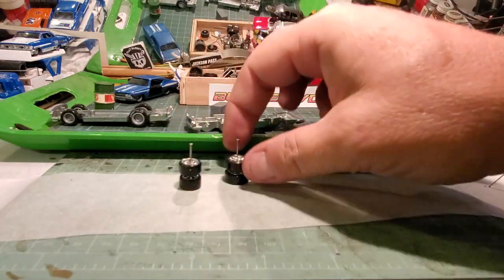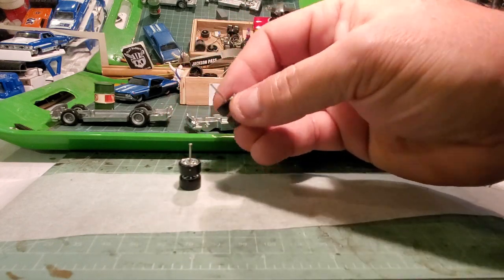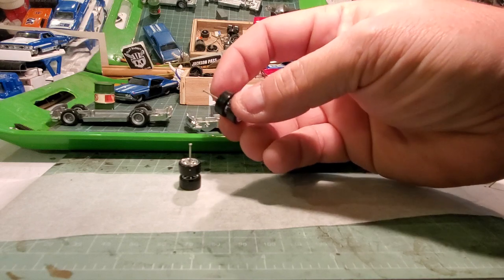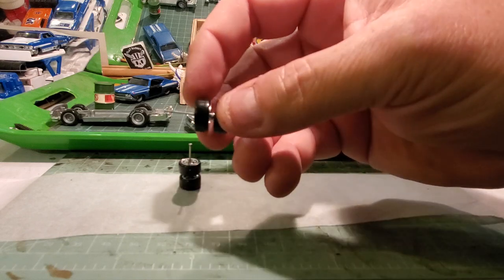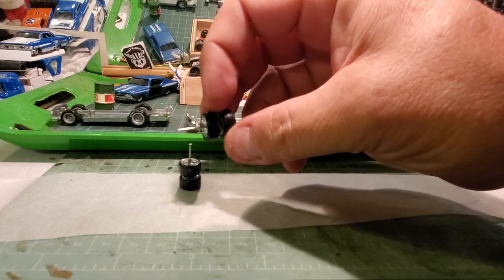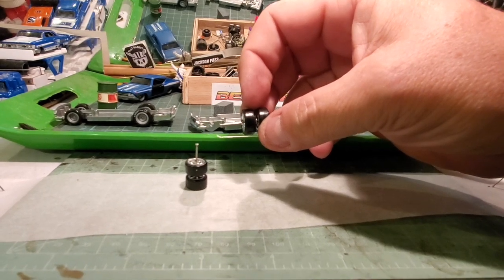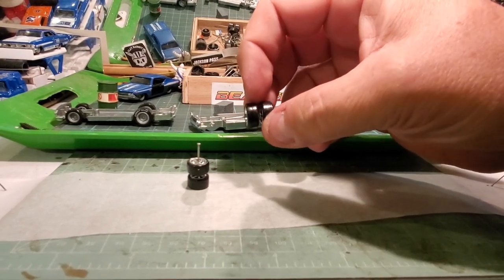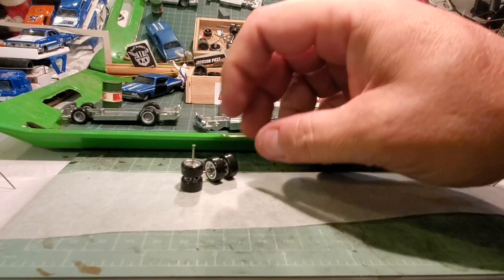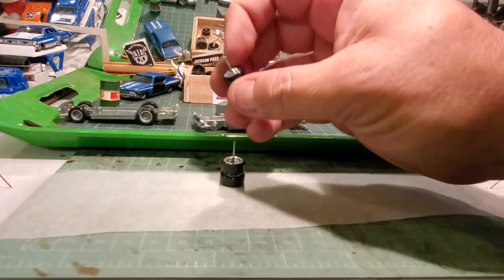And we're going to put a little axle polish into the ends here. You don't have to polish the whole axle, just where the wheel's riding. You can see there's some crusty corrosion and stuff all over the end of that axle already. I don't know if you can focus it. But yeah, there's some debris and carnage to pull off the ends of those axles, both sides.